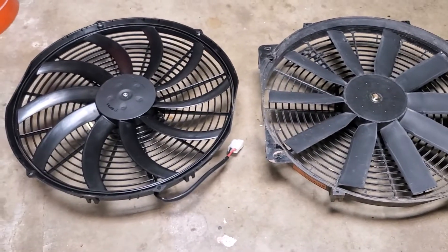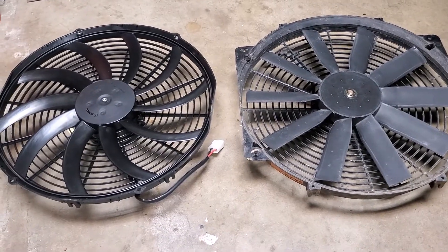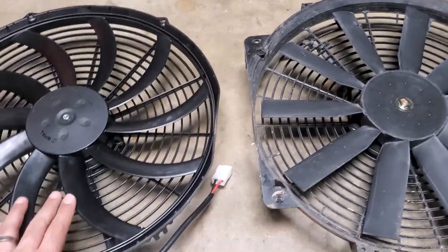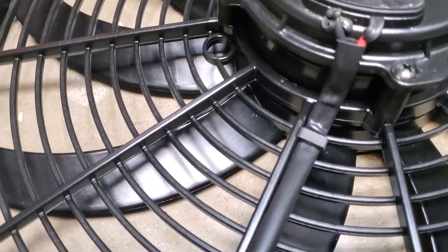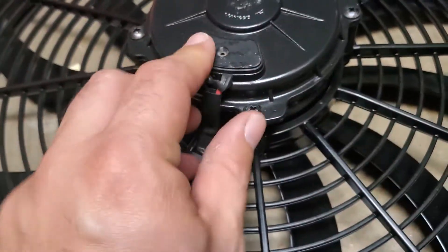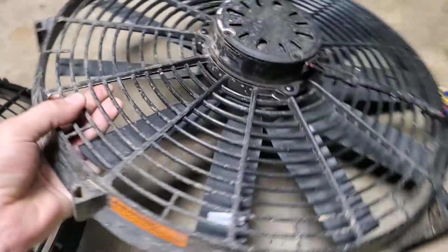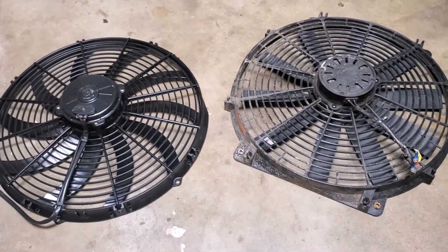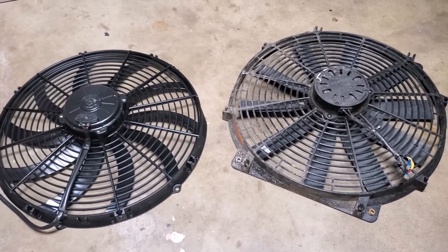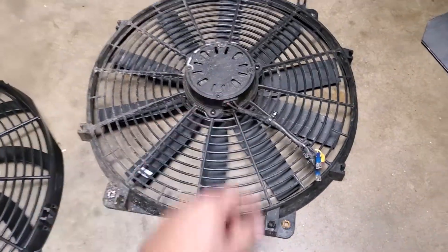The design of these two fans is so different that it may not be easy to distinguish that effect between the two, but I did want to point out that design detail. Another thing I like about the Spall fan is how nice the seal is — you can see the RTV coming out, they've got a nice little panel so they pot everything and press that in. Whereas on the Flexalite fan, they kind of just have a rubber grommet and stick the wires out the backside. The Spall fans do tend to be a little bit better sealed compared to the Flexalite.